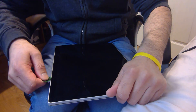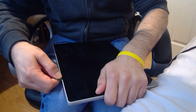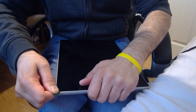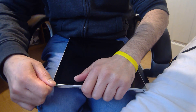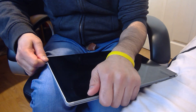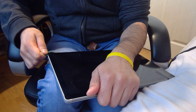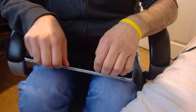Use your pick sparingly — I tend to go in about just that much of the pick, just go past those connector areas and then come back past again, so I'm not forcing that area. Take it gently; as long as you know where your thumb is on the glass, you won't shear into the cables.